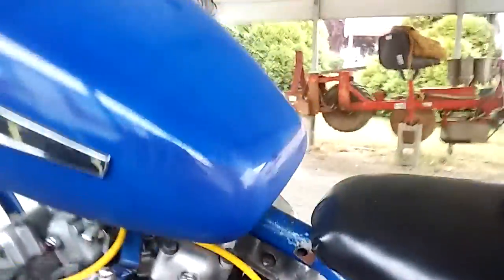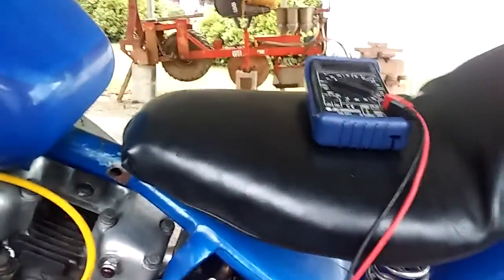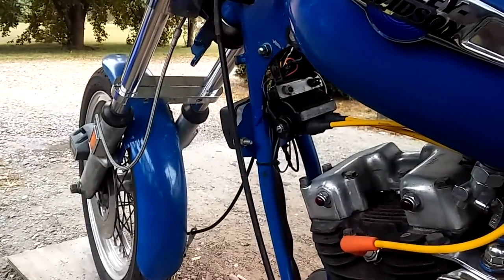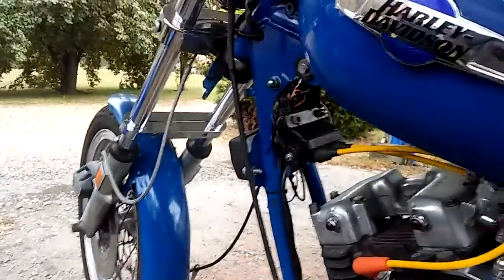it's pretty good. So I've literally only lost 0.01 volts in 4 days that it's been sitting here. Of course, I have a good battery, and I recently have tested my regulator, which is right up here in the front. It helps keep it cool, and that's where the least amount of vibration is.